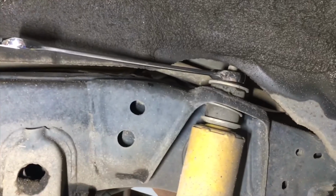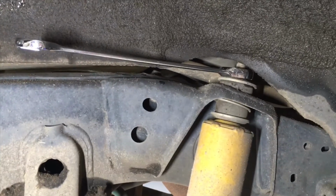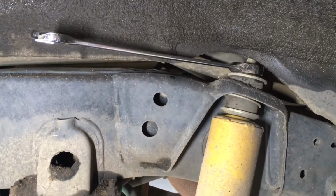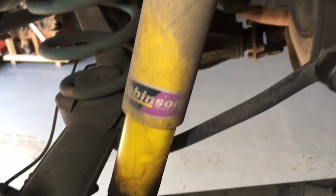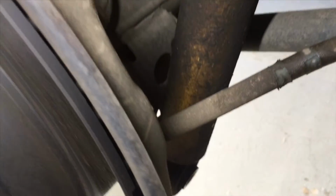And I just wanted to show you. So we've got the 17mm ratchet spanner on the top to undo that, which we haven't started yet. I'm not going to have the whole action video. You know how to undo a nut, and that'll just compress down and come out, and you can close that up, push it down, and then take this bottom bolt out.